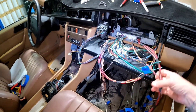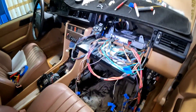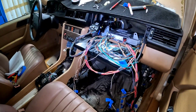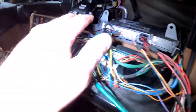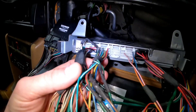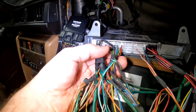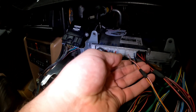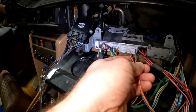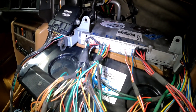It looks like a mess, but it's really not. These wires are all powers, these are all grounds. Once I've confirmed everything works I'll come back in and cut everything, make it nice and pretty. On the actual ECU, there's really not much to make this thing run. B1 and B2 are pretty much all your sensors, F59 is your starter signals, and F60 is pretty much your powers to the ECU. Super simple.